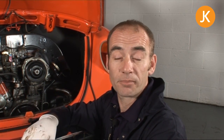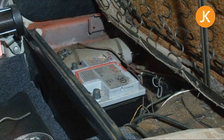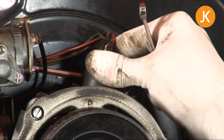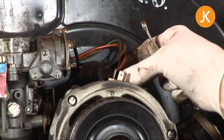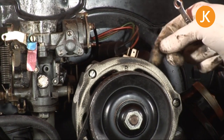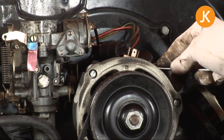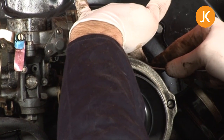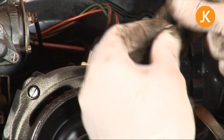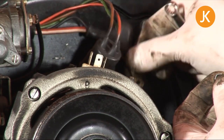A couple of points to remember when taking the various parts of the electrical system off: if you're not familiar with it, then by all means use a piece of masking tape, write something down onto it, or do yourself a little sketch so that you know they go back together again. And of course you can always take a picture with a mobile phone or digital camera for reference later. Please make sure that you have already disconnected the battery. Now this happens to be an alternator model with multipoint connectors, so that's fairly foolproof — you can just gently wiggle it off. If you had a dynamo, you'd have a DF and a D+, and it's fairly obvious with those so you can't get them confused. One should have a spade connector, the other has a ring connector, and you'll have a little earth one around the back — they will basically have little 8mm securing nuts. A good idea to hold the back of the wire so that you don't spin the post and break the connection internally. The best thing to do with these fiddly little nuts is probably to put them straight back down as soon as you've removed the wire.